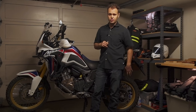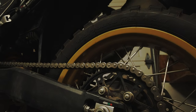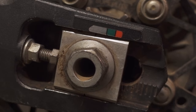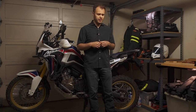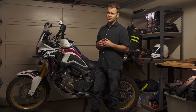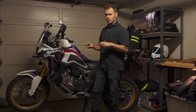One other thing to mention: if you change your sprocket size, you'll probably need a longer chain — probably about two teeth longer — so you may want to wait until you're changing your chain anyway. The markings on your swing arm to guide chain adjustment are going to be off now, but don't freak out about it — the geometry has changed a little bit. It will also slightly change your wheelbase, but again no perceptible impact on handling. I highly recommend making this modification — it's easy, relatively inexpensive, and makes a huge difference to off-road slow speed handling.